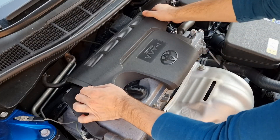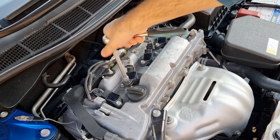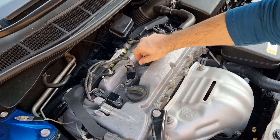We're going to start with removing the engine cover, unplug all ignition wire harnesses so we can remove the ignition coil, and then the spark plugs. It's been a long time since I haven't cleaned carbon buildup on this engine, and I'm pretty sure there's a lot of carbon buildup forming on the pistons right now.